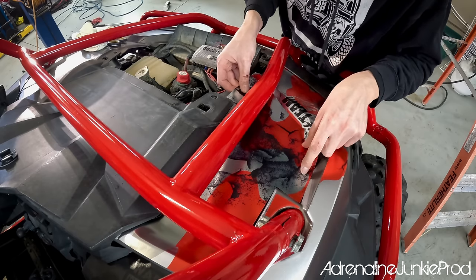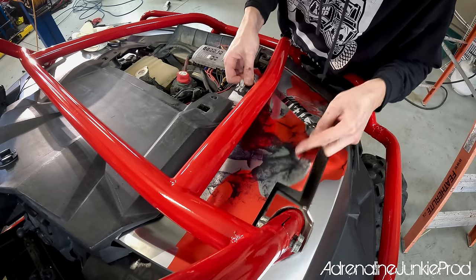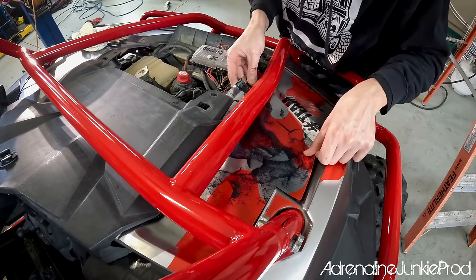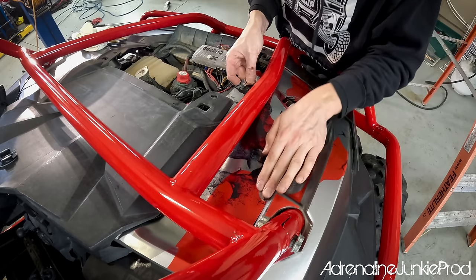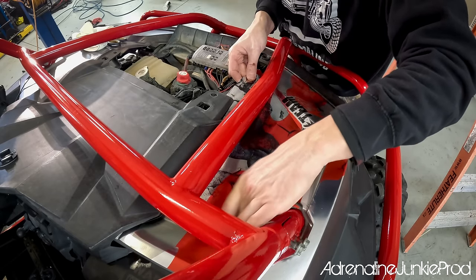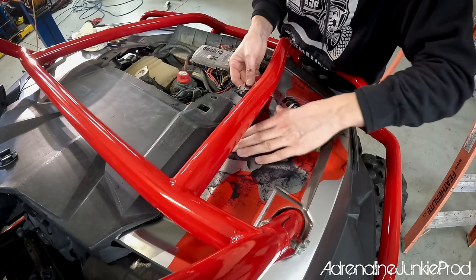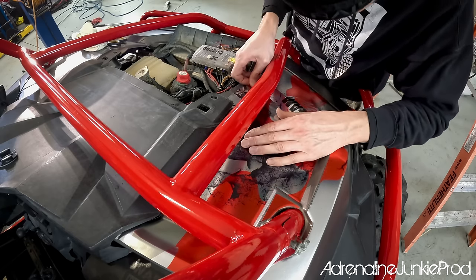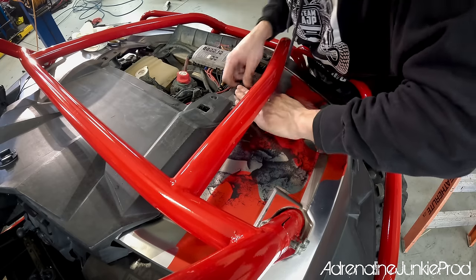The vinyl pieces themselves shouldn't really overlap on top of other vinyl layers — they're all cut to fit. There will be some gapping in certain sections, and there might be a little overlap sometimes based on variances in the body panels or if you've smacked something, or if the cut tolerance is just slightly off. All these machines are a little different, so sometimes all the cut lines won't line up perfectly — it's just the nature of the beast. The vinyl is actually quite thin, flexible, and stretchable, but the over laminate layer that gives it its protective off-road qualities doesn't conform and stretch as well, and also gives a lot of the thickness to the material.